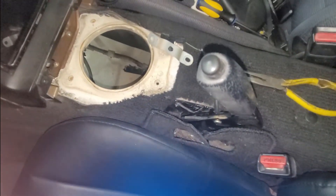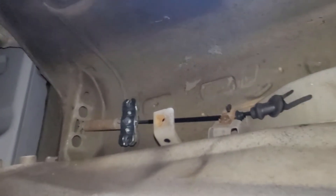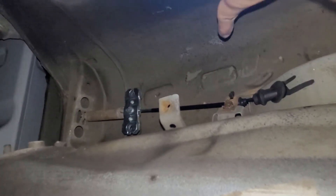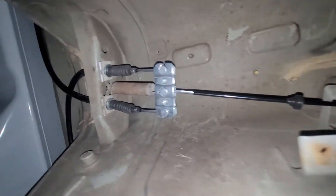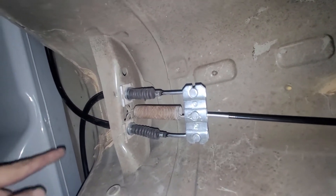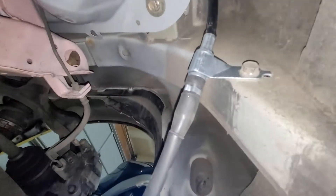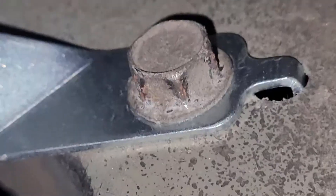So now let me show you underneath. As you can see, it looks about right. We got the thingy, the little bolt piece, the spring — now we're ready to put the two cables on. To put these rear cables back in place, you'll want to first snake them through in the appropriate holes. Remember that they have to cross each other. You'll know which one's which because of these tabs — they can only go one way. If you have them the wrong way, these little pins won't go into the hole; they'll be sticking up instead.